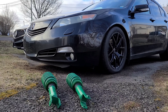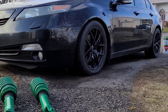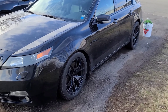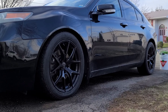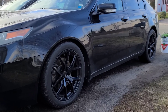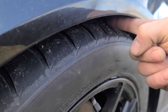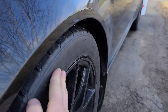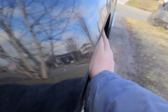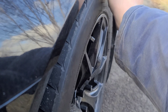As you can see, the front ride height is a lot better than the back. The higher up you stand the more you see it, so it depends on the angle. When you're standing up it looks perfect for me — one finger clearance — but you're still rubbing the tire, so I kind of want to get some spacers just to make these come out a little bit more to the point where I won't have to roll my fenders.